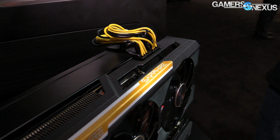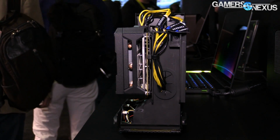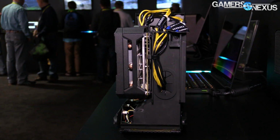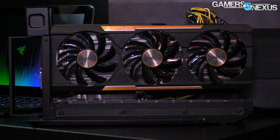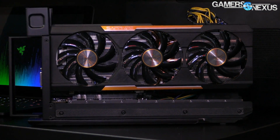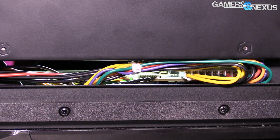On the rear side of the enclosure, there's a gigabit Ethernet port, which will obviously take up about a gigabit of your bandwidth. There's also 4 USB 3.0 ports, which operate at somewhere around 5 gigabits per second, 4.8, and with 4 of those at about 5, you're running 20 gigabits per second with Ethernet at 1. So saturating all of that fully, which is pretty unlikely, you'd be running your GPU at a fairly hamstrung speed. It would be suboptimal, but because the USB 3.0 ports will almost never be operating at fully saturated speeds, unless you're driving a bunch of external drives off of it, it's really not that much of a concern because the PCIe x16 at the 40 gigabits per second USB Type-C or Thunderbolt 3 protocol will be plenty for most gaming.